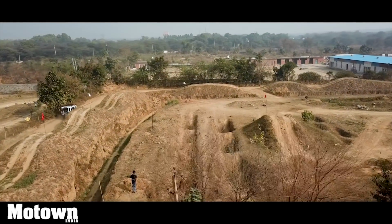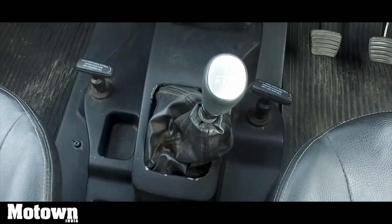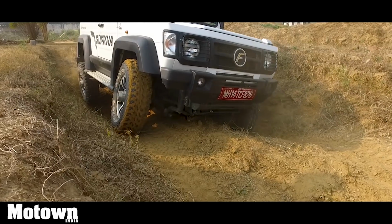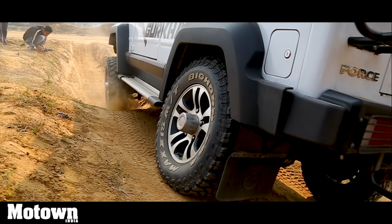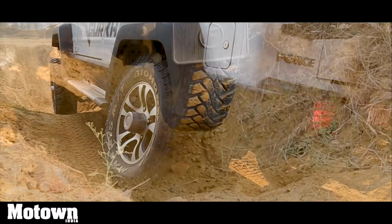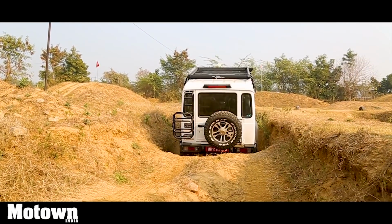The new Force Xtreme comes with differential lockers both for front and rear. This feature will come in very handy if your vehicle is really beached. Essentially, what diff locks offer is something which goes beyond the purview of the four-wheel drive. While a four-wheel drive brings out a vehicle from a sticky situation, it becomes helpless in case of an extreme situation where you lose traction on both the axles. That's where differential locks come to your help and pull the vehicle free.